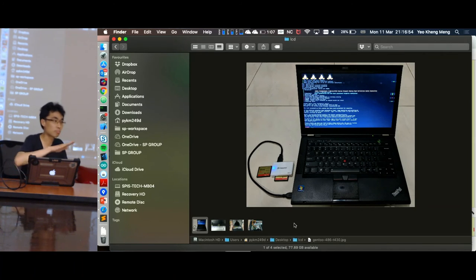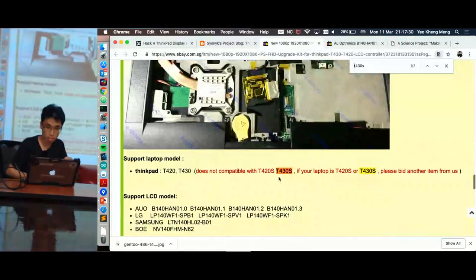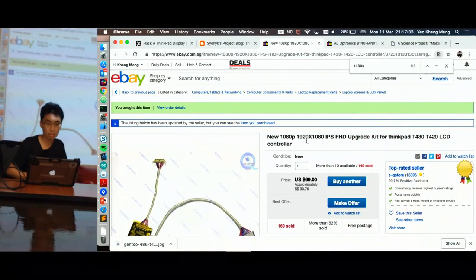No need. It's purely transparent. Yes. Okay, it changes the resolution. They recognize the new resolution automatically somehow. So the OS recognizes it. I mean, the OS is the easy part, but it's actually interesting if you think about it: this connector is an internal connector originally from the video card to an internal display that's supposed to never change. And yet when you plug in a different display, it does the song and dance to find out the supported resolutions and then switches. Because this one, I think this adapter is fixed at 1080, correct. So they only tie to a 1080 display.